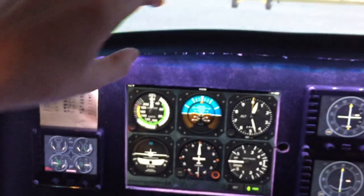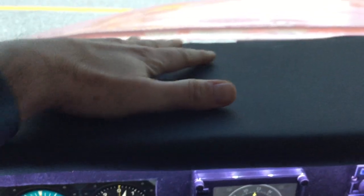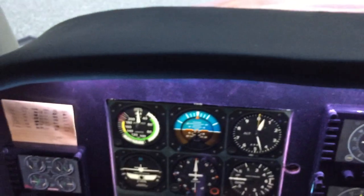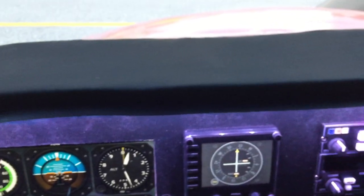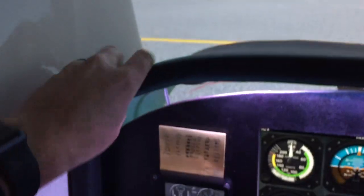The glare shield is one-inch thick high-density foam covered with leatherette, and I just made it myself. I couldn't get a strip of leatherette long enough to go all the way, so there's a small seam. I simply cut a 9-inch wide segment of high-density foam, covered it with leatherette, used spray adhesive to hold it down, and it just slides into place.